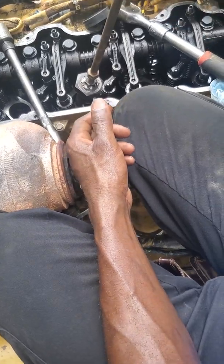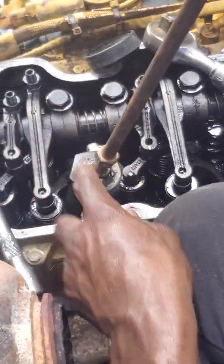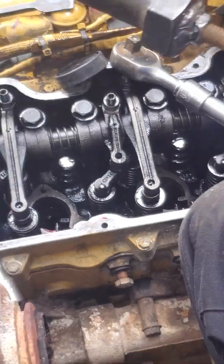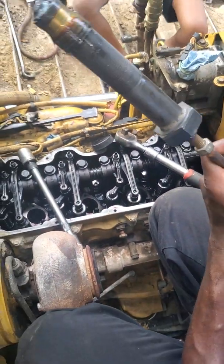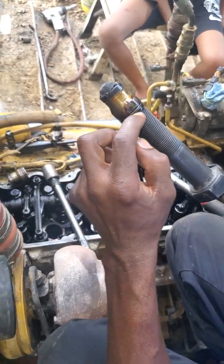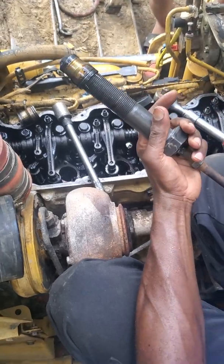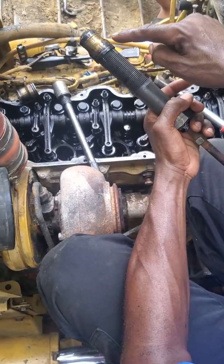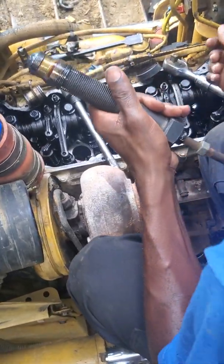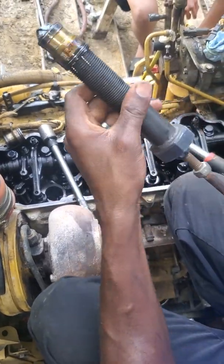See how hard it sounds. It sounds different now — until it's moving. If you zoom in on that, you can see it slowly moving up. Now, pull the piece we've been looking for out of there. That was letting water get through there, up past the O-ring — letting diesel get from there to where the antifreeze was. And there you have it, injector cup removed from a CAT 3126.